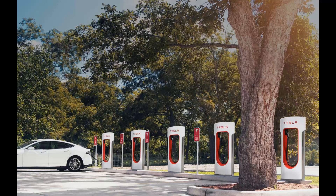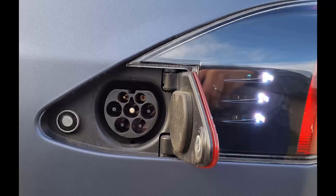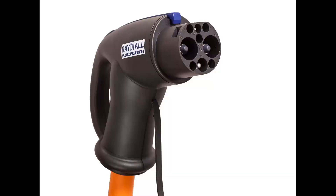Here I have to mention Tesla Supercharging because in 2012 it was the first widespread DC fast charging solution, currently running at 120 kilowatts and over 11,000 plugs worldwide. Tesla cars can accept AC or DC through the same small, beautiful plug. Tesla also has the downside of a US plug of their own design and a modified Type 2 plug from Mennekes for the European cars. Tesla offered the use of its Supercharger network to all other EV makers, but nobody took them up on the offer. And of course the Chinese have their own GB/T system with separate AC and DC connectors.